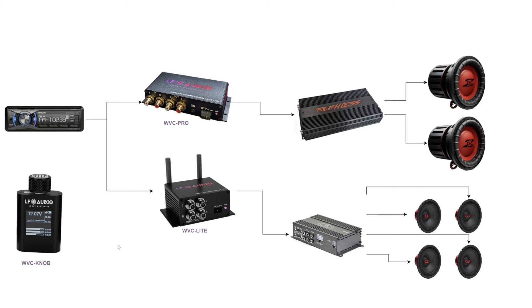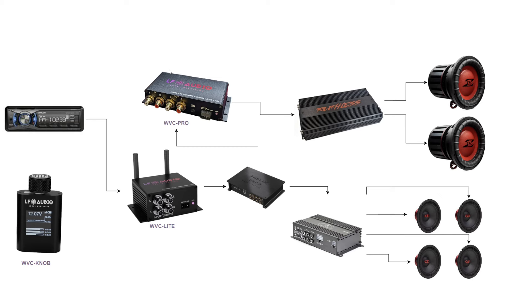So this is one option — some folks may be okay with it, others may not. Option number two involves adding a DSP into the mix. We get left and right out from the main head unit, which we use as master volume up and down. The DSP creates the separation between our mids and highs, along with any delay and crossovers needed. This gives us master volume control, since most head units only put out two channels for most audio tracks anyway. We then simply add our second unit to the subwoofer output of the DSP.